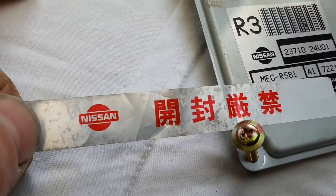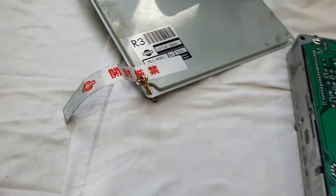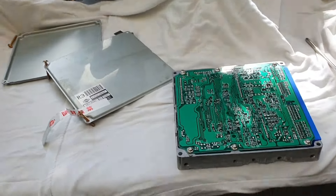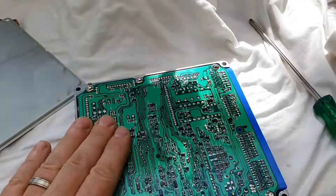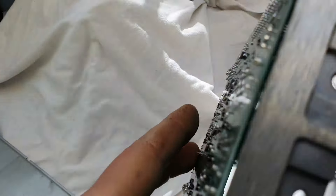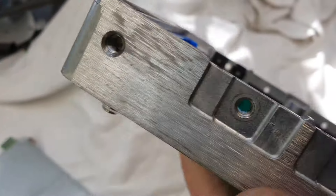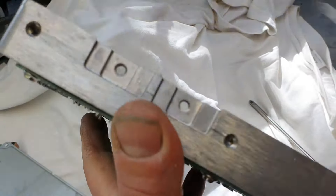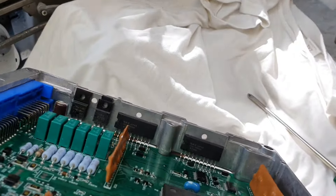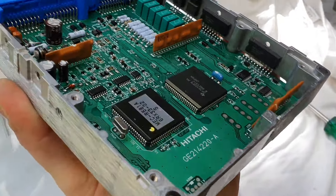So I went to do that this morning. I'm not sure about this sticker — can you read Japanese? What does that say? Is that normal — does that say warranty removed if you take that off or something? Anyway, you're supposed to just unscrew the board, so I'm busy undoing all the transistors off the side here. See those transistors? They're clamped onto the case to dissipate heat. You've got to undo those — sometimes they're thread-locked, and they weren't on this one, so that was nice. I was thinking, oh, it's going to be a good morning!